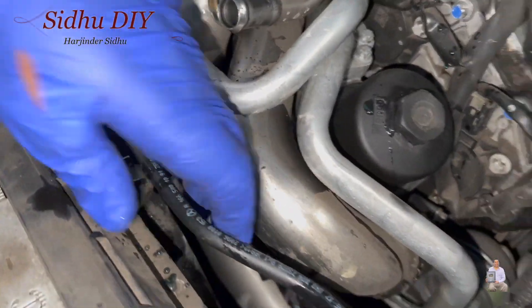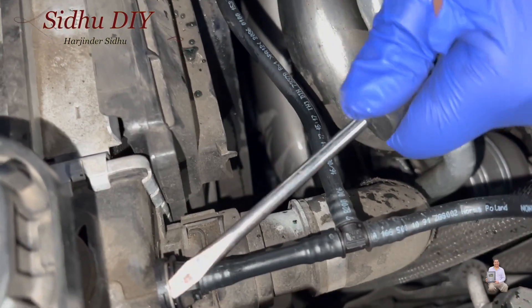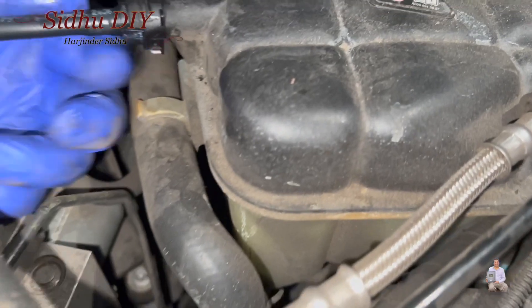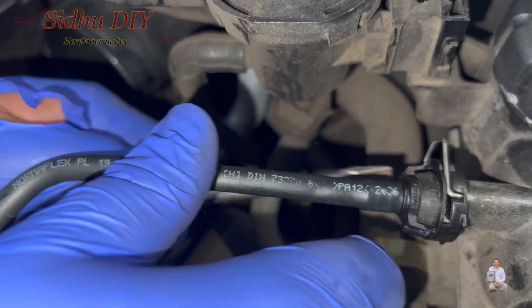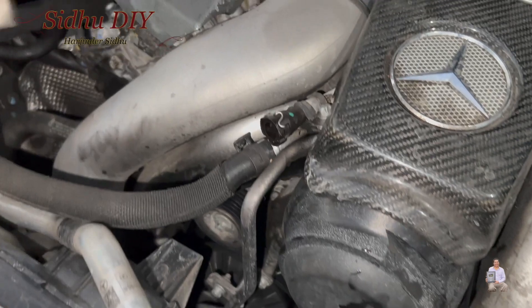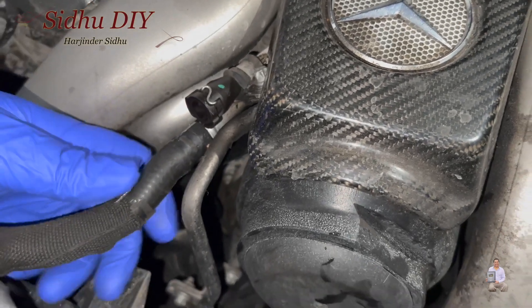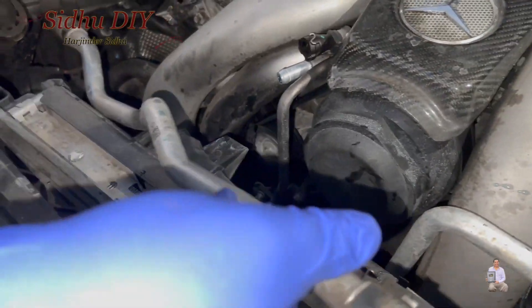Once the pin is up, the hose comes out easily. Push the pin back so it won't drop. Then open the clamp on this side using a straight screwdriver. Push the pin out and it will come free. Now we open it and this whole assembly comes out — just leave it up here. Now we're going to remove the number four hose. We pull the number four hose and now we have enough room to move these hoses to the side.